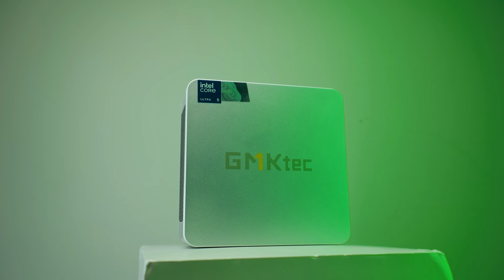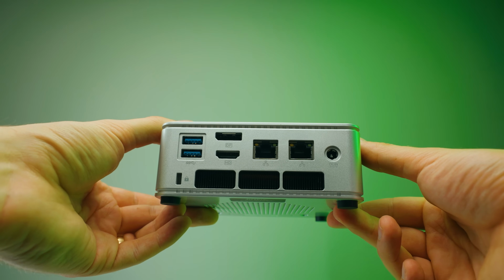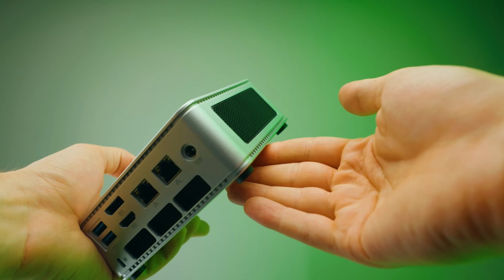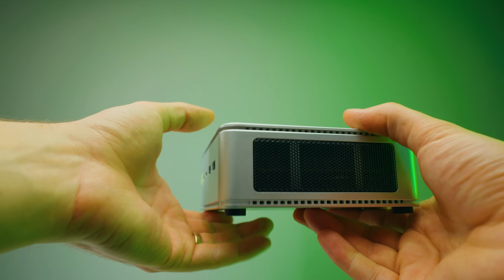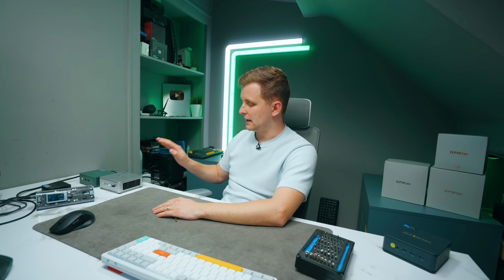The one thing I noticed when setting up this PC, when the PC goes to idle, the fans actually go to idle as well. So the fan curves are linked to whether the PC is awake or asleep. But when it is asleep, it goes very, very hot. So whenever you turn the PC on, the first thing is the fans kick in and start to cool it down because it's very hot, like hot to the touch. Now, I don't know how good this is for the components. They should be cooled down all the time. I'm hoping that a firmware fix or BIOS fix would come out for this one. Then it will be sorted.